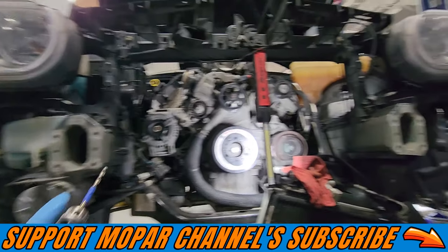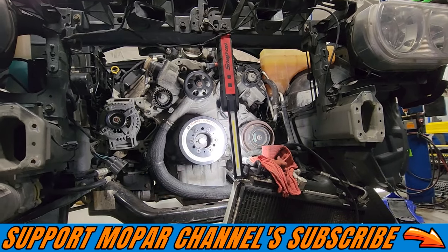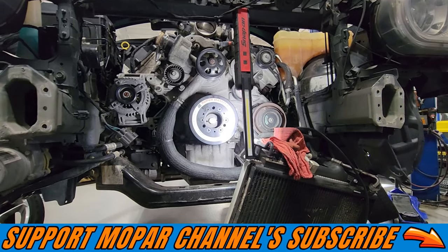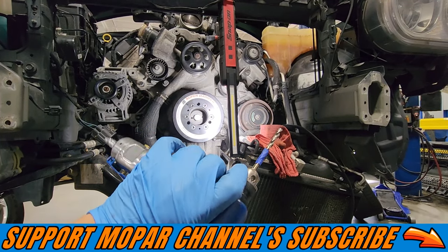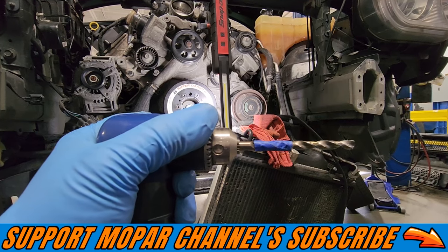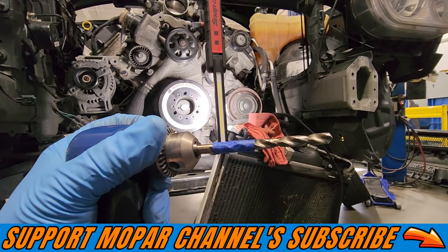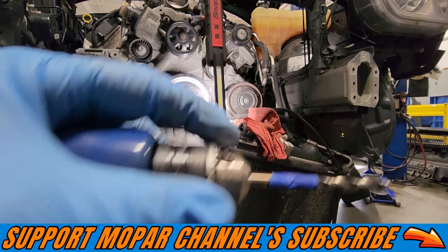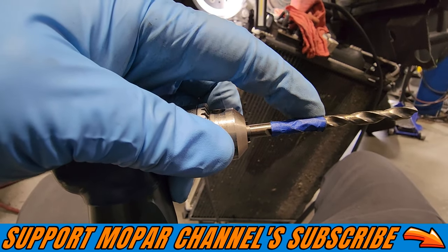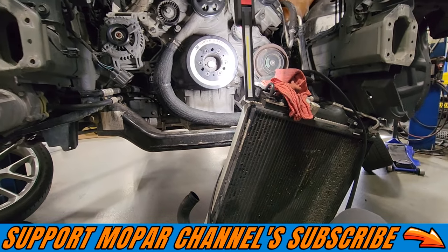As you can see, we got the whole front bumper off the crash bar, and it is super comfortable to work on it like this. We got our 90-degree drill bit and we already have it marked — the Torque Storm directions tell you how to measure it to mark it so you know how deep you need to go. We need to drill right here to the back side of the tape where my fingers are at, so that's how deep we've got to go.